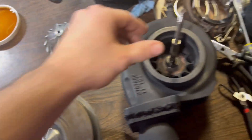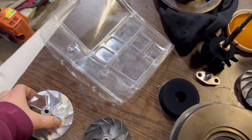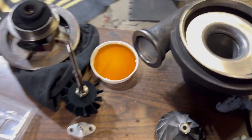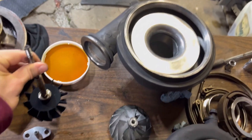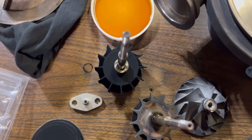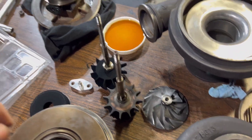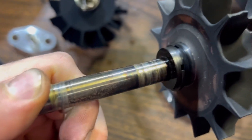I've got the other turbo out of the truck and picked up the new comp wheel — looks pretty snazzy. The larger one is the 8477 or 8476, and for comparison that's the 8470 — you can see it's quite a bit bigger. I want to point out that I said earlier in the video you can interchange parts from the HX-50, HX-52, and HX-55, but some of the turbine shafts aren't interchangeable. Lucky for me, mine are.